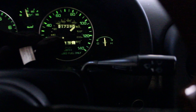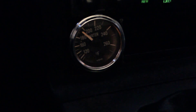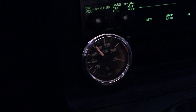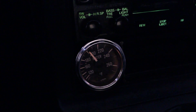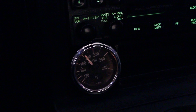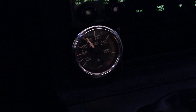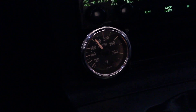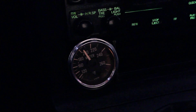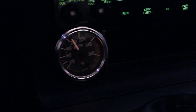It won't really move from like 150 to 220. So I have this real gauge right here. But essentially the factory ECU doesn't kick on one of the cooling fans until about 210, and then it does this cycle between about 190 and 210 when you're sitting on grid or in traffic. The point of doing this mod is just to keep it consistent and have manual control over your temps. For example, if I'm on grid and I'm about to take off at around 210 degrees, that's not going to be optimum — I want to start my run at 180 and not have to worry about overheating.